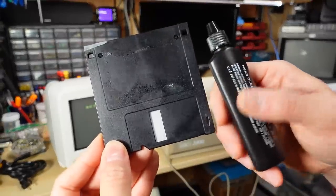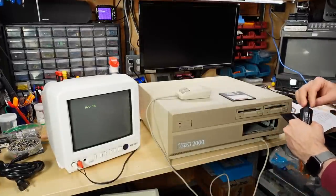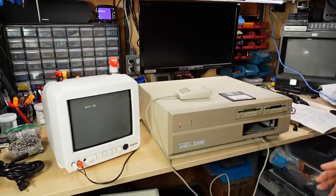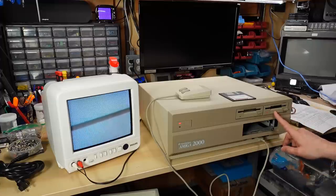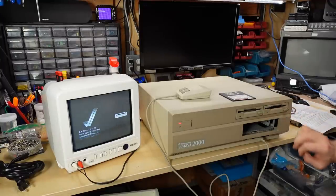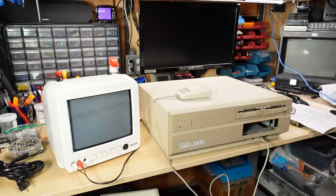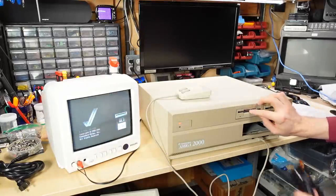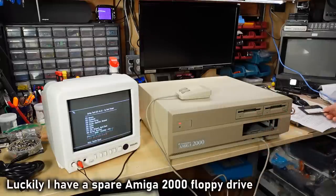As a quick fix and experiment, I'm going to use this cleaning disc with cleaning solution on the drive on the right to see if it makes it read the disc properly. Let's turn the machine on and put that in. We'll do that one more time. Let's see if the test kit floppy is working better now — and it is not. It did not boot that disc even after the cleaning disc. I know I need to do a repair on this. That'll be for a different video.